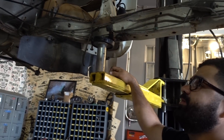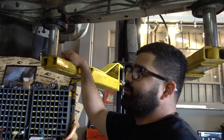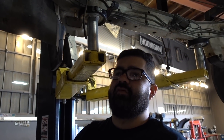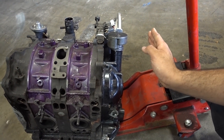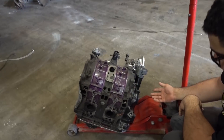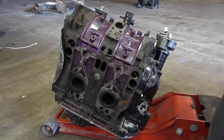With ITBs we can make that work — 100%. We just have to play with how much it'll affect the engine if we bring it in close. The header is the main concern — the header needs a little bit of space out of the collector. When I sat it back up in here, that crank pulley was about five inches away. Since we're running only an alternator, the crank pulley itself is going to be under three inches. If you have the factory water pump the pulley will be about here, but running just the alternator the pulley is going to be right here. For mounting the engine, the easiest way is here — we'll mock it up and I'll show you.